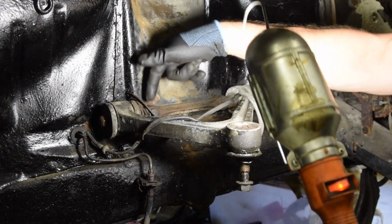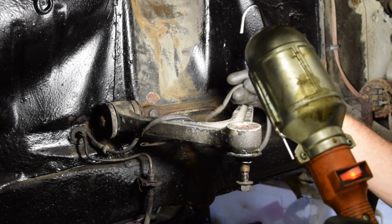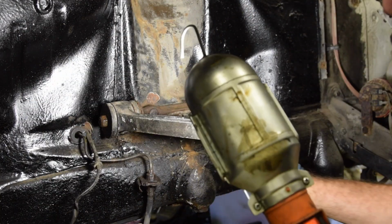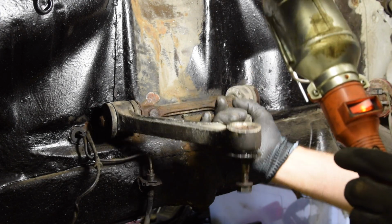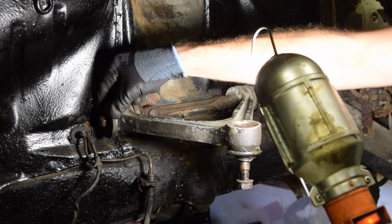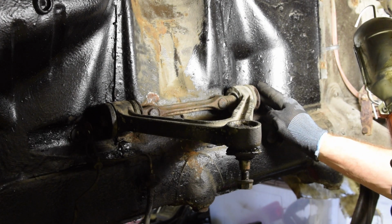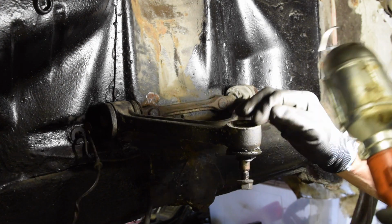So these are the ends of those two bolts that are undone on the other side. That's also my brake wear sensor, so let's get that out of the way. There doesn't seem to be anything holding that in apart from time. It definitely needs to come out. The bushes on this are completely shot. I've undone the bolts either end. Actually, I've not undone this one, so let me undo that one first, because it's much easier to undo with it in the car apparently.